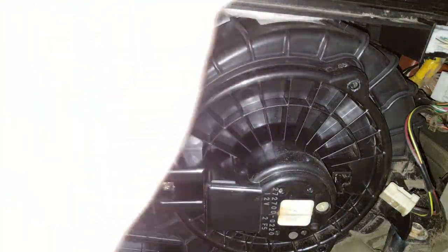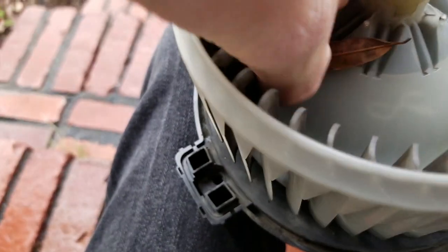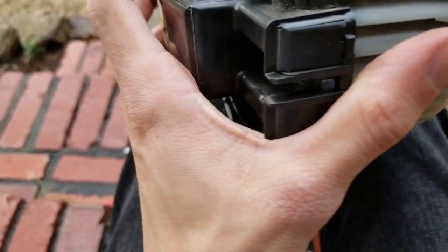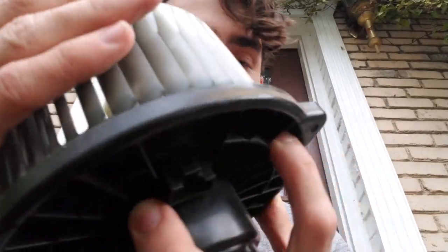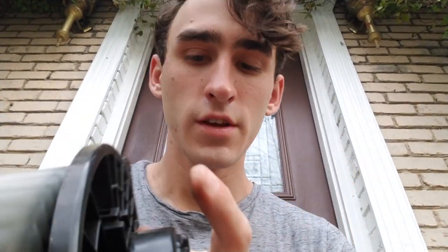This is like the happiest moment of my life — oh gosh, ruined because the stupid thing fell off the ratchet. How about that, how you like me now Subaru. There's some debris in here, but honestly I don't think that's what's making it loud. I think there are some bearings in here — when this is spinning at a bajillion miles an hour, I think that bearing noise is probably what's making the roaring sound. It could be that, which makes a lot of sense because bearings tend to go out, or just the whole motor is screwed.